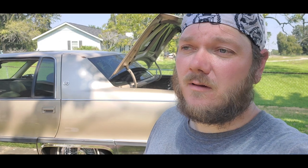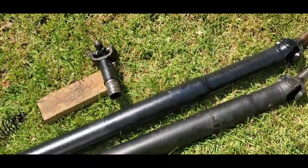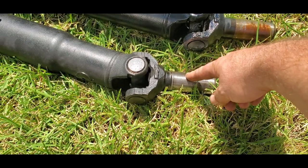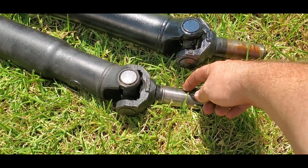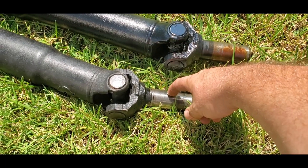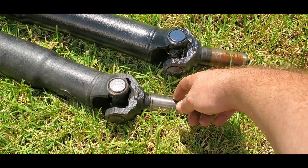One of them is going to work. This one here is going to work — it's going to have the right amount of slip. Mine just needs more because it goes up higher. I got the end of this driveshaft taken apart — this is the one that will work. When I put it in the vehicle, this side over here had about an inch of stick out when it was all the way down, which was good. When I lifted up, this bottomed out into the tail shaft of the transmission. Before, when this car had stock suspension, I could ride it lifted up and never eat the tail shaft seal. The Blue Rose had the same size cylinders, lower springs — less coil in the back — but when you rode it all the way up it would just wipe the tail shaft seal every time.